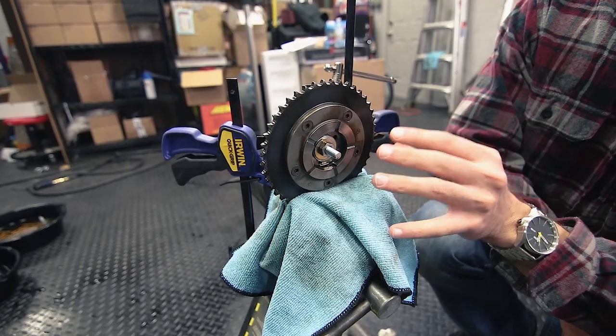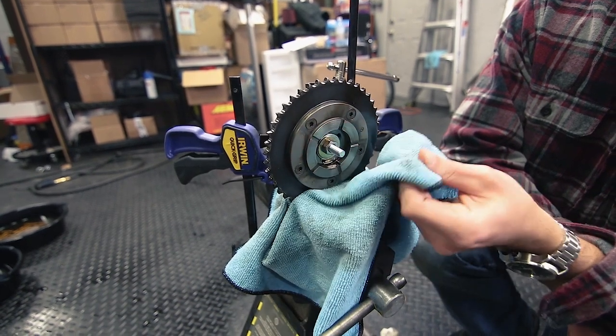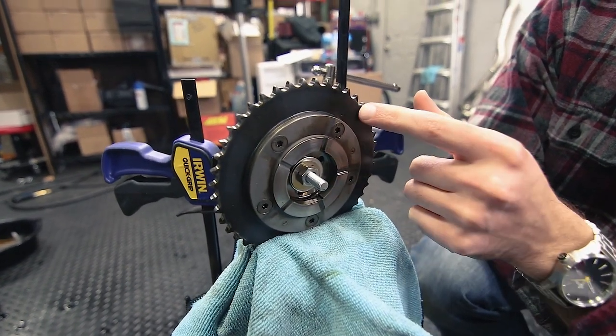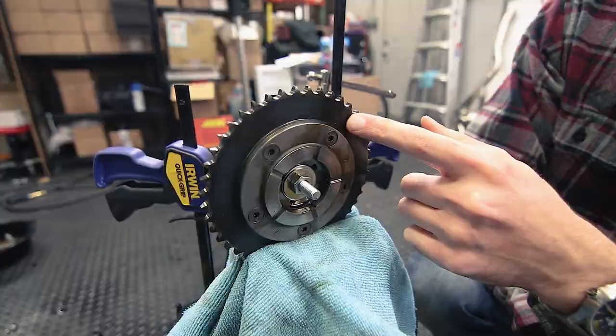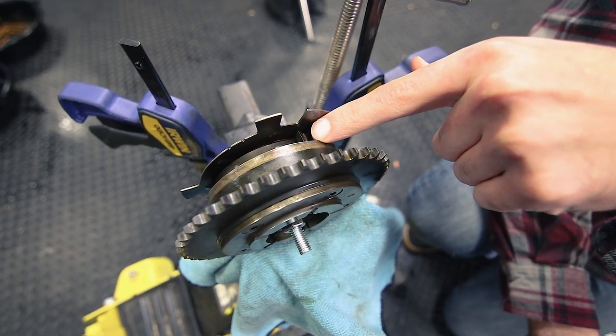This is how you're going to want to fasten the cam gear in the vise. You'll also want to have some sort of protective cloth to prevent damaging the cam gear. If you look where this notch is on the cam gear, that denotes the cam gear pin bolt — you're going to want to orient that at the two o'clock mark. If you look on the back side you can actually see where that pin bolt is holding the spring.